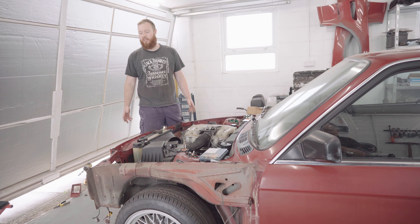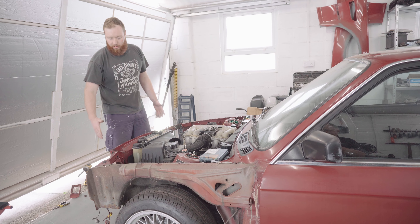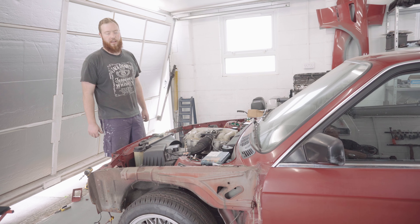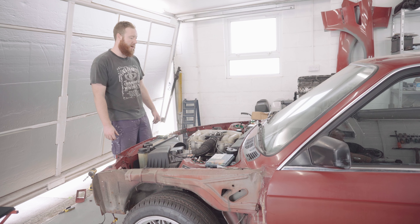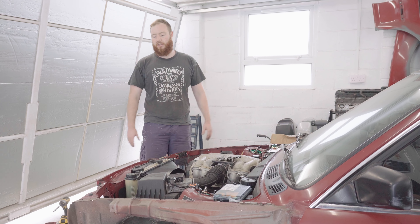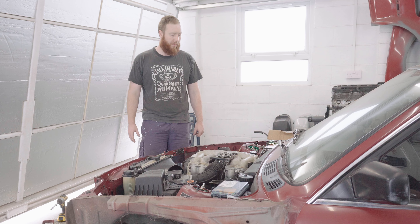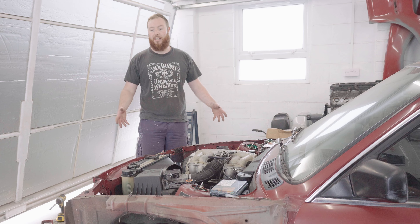So that's all the front end panels removed from the E30. I'm really relieved to find the accident damage is actually pretty minor. The chassis legs look straight as they would have come from the factory, so I'm confident this car's not been in any big smashes. This is a solid, straight, good shell. But I always knew it would be, because having seen some bad E30s, I knew this was going to be a good base for the car I'm trying to build. The worst thing about this job today was actually rusty fasteners in this driver's side wheel well, which was a real pain in the arse as it always is. But they all came out in the end - well, most of them came out, and the ones that didn't are now destroyed so I need to replace them, but that's no big deal. So hopefully if you need to do this same job on your E30, some of this information is actually helpful for you. It's pretty straightforward really.